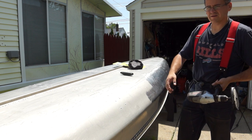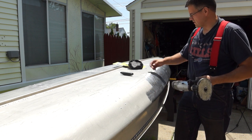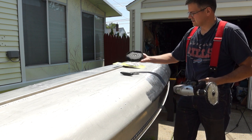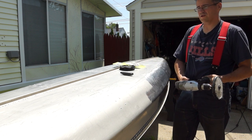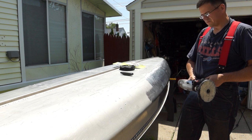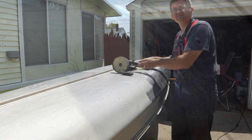Going down the whole side — I'll do a close-up so you can see the difference. It really does a good job, and then when I follow up with the medium disc and the red compound, it takes it to a pretty good mirror finish. Let me bring you in close so you can see what's going on. I'm going to bring you close on this area here and actually swap out the wheel and do this area nice and polished.